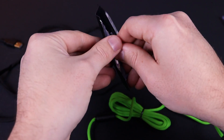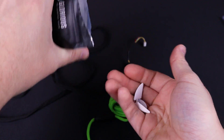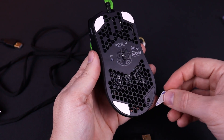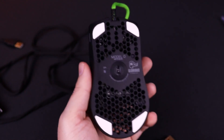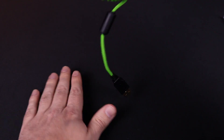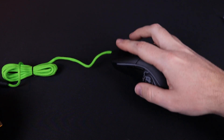Once those are in and finger tight, do one last check to make sure everything is in position, then grab the new skates which come packaged with the new cable. These are 3M so they are the best of the best. They stick very nicely, and if you're worried it's quite easy to line them up inside their little shells and holders before sticking them. Clear your surface area and give the mouse a little push into the mouse pad to make sure all those feet are stuck down nicely, and you are ready to game.